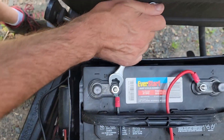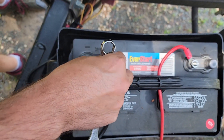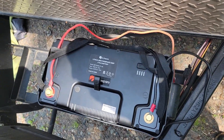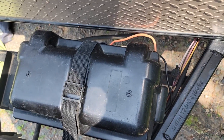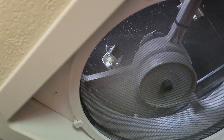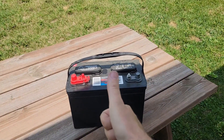Let's get to work. When you are undoing your battery terminals, make sure that you don't connect the two battery terminals to each other with your wrench — that would be a bad day. Now the new battery is in. Very easy, straightforward replacement. The new battery is slightly bigger than the battery box, but not too big that you can't manage getting it in there and still getting the lid on nice and tight. Let's get that battery cutoff switch turned back on. The light is already on and the fan is up and running — fantastic. Now we go back onto shore power. Be sure to take your old battery down to the recycling center; they'll give you some money back.